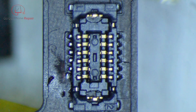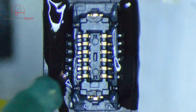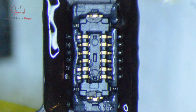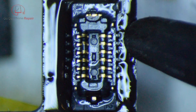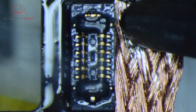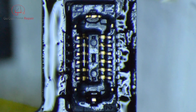Now this is the phone being repaired, and I've cleaned up around the connector so you can see where that corrosion was. The main concern is the board — I don't care if this connector gets destroyed in the process, but we want to make sure we don't float off any of those footings, otherwise we just create additional work. I am going to add some leaded solder here because I'm very concerned about those connections on the board. I want to make sure those don't get damaged while I take this off. This should make the job safer.